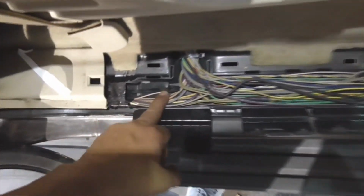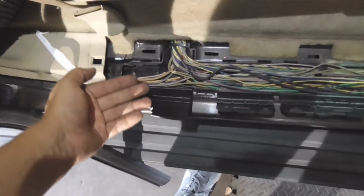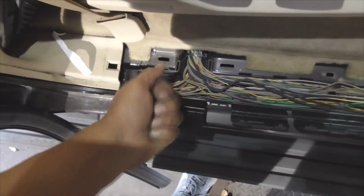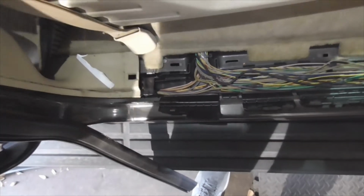Just a quick reminder, guys. The thing about these fish tapes is that it's got a plastic end on it. And what that allows it to do is, I mean, it fed through all the way up to about here, guys. Easily. So if you do use a coat hanger, I would recommend you take a pair of needle nose pliers first, bend the back over, crimp it down so that you've got a nice nub on the end. But get this wiring passed through here.